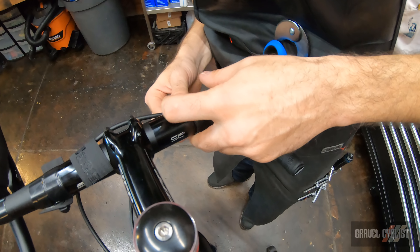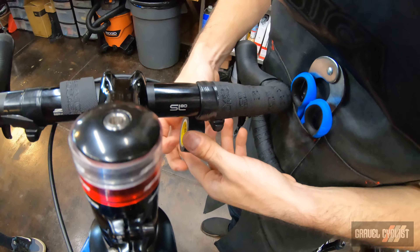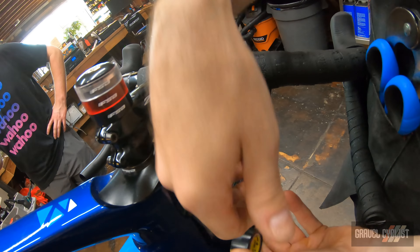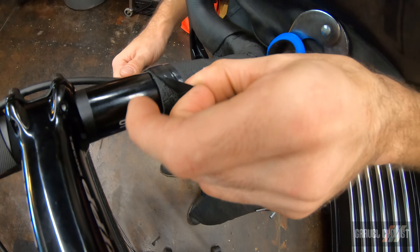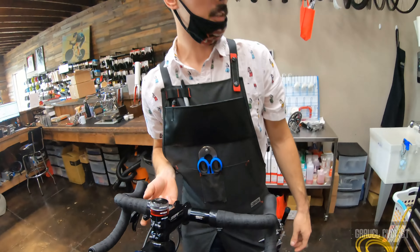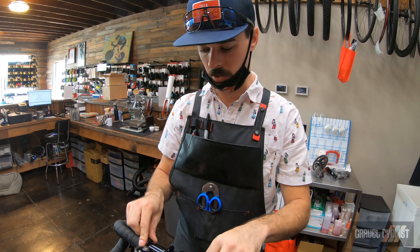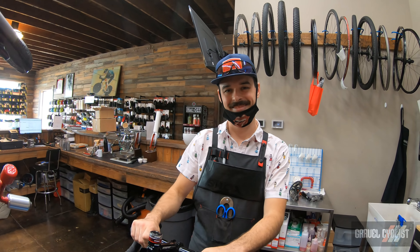Just using electrical tape to tape off the finishing edge here — keep it nice and tight so this tape doesn't come unwrapped. Everybody's got a different opinion on how to finish bar tape. I usually use a layer of bar tape wrapping in the same direction of the tape. We're all done — nice even gap here between the stem and the bar tape. John just likes to use black electrical tape to finish off the tape. Sometimes you can use that logo finishing tape, but I'm not really a fan — it leaves kind of a crinkled edge. So just plain black electrical tape, a couple of layers, keeps it nice and tight, keeps it from unraveling. We're good.